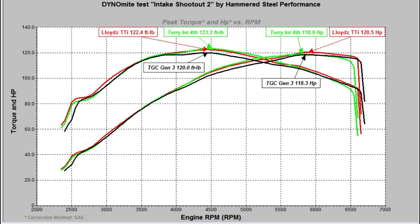I did each one of these on a different day over the last three days, so we had a little bit of varying temperature and humidity — I think this is pretty much a wash. They all make power, they all do very well on this combination. It's a 92-inch with 100-inch big bore, 106 pistons, 495 cams, a little light port work on the heads, 48.5mm throttle body, and a custom exhaust with Sonny/Road Rage headers and my own collector. You're looking at about two to two and a half percent variance on these intakes.